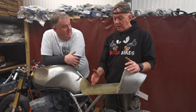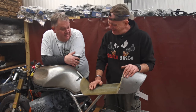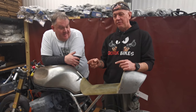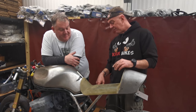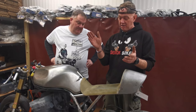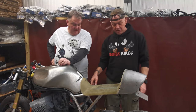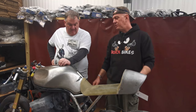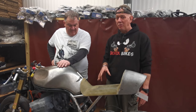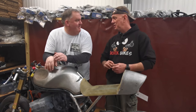And then once it's all done, and it's all back on the bike, and we have an exhaust system and everything else, we got to measure the whole damn thing again. Because with different spring rates, we're going to get different sag. And we're having a different top mount made for the rear shock, and that's essentially going to be our ride height adjuster. The one that we've got in there at the minute ain't long enough and it needs to be longer. So potentially the angle of the swing arm and all that stuff is going to change again. So we're going to have to go through this whole exercise again. But at least it means we're in the ballpark now. So we ain't going to have any major surprises later on.